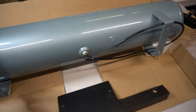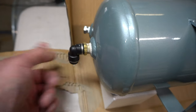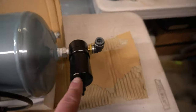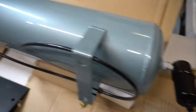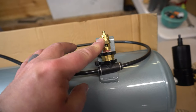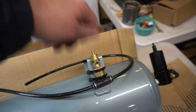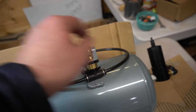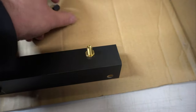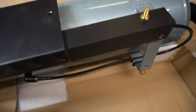So I pulled everything out last night and connected all of the fittings. This is where our intake from the compressors is going to come in, and then this is where the out is going to go into the manifold. The drain — I ran a line in behind, so this quick dump is going to be behind the tank. I'm going to put a 'remove before flight' flag here so you can just pull it and it will drain the system.